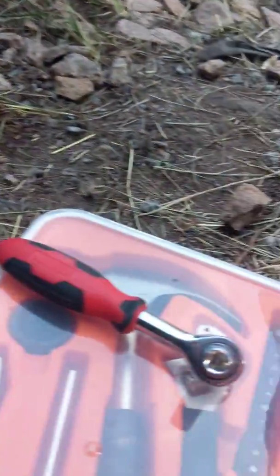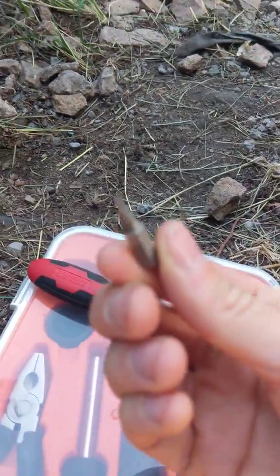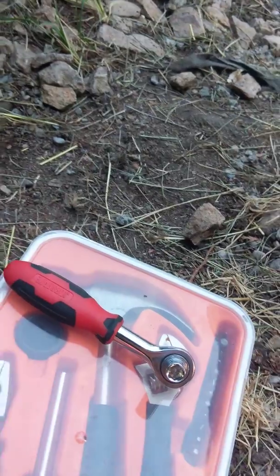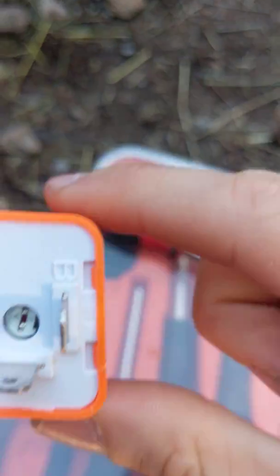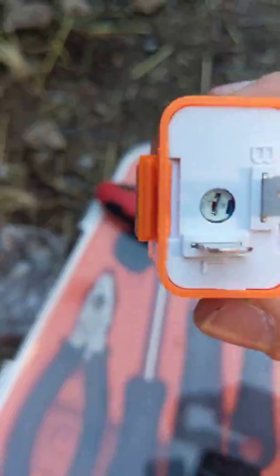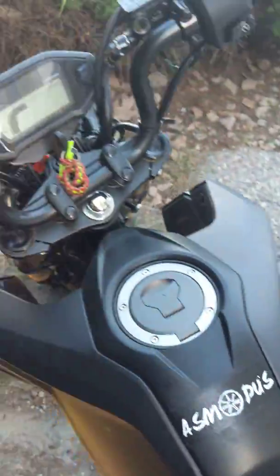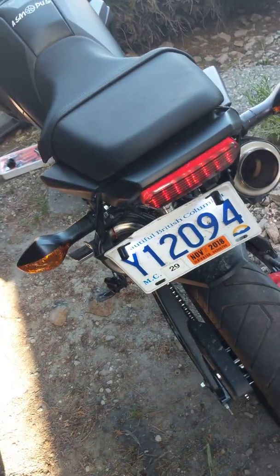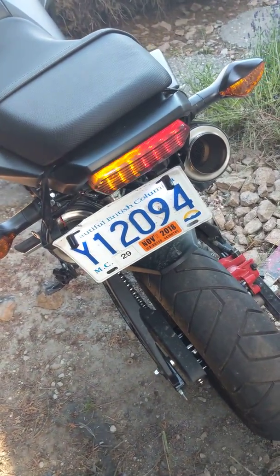Bear with me. So I just took a little flathead screw bit and stuck it in the little hole there, and I spun it. Boom. So I just spun it all the way to the right to slow it down. There we go. Now we've got a normal flash. So I'm going to be taking these guys off and using that as my stock flash.